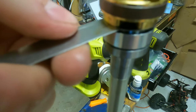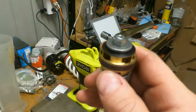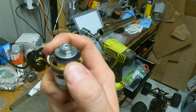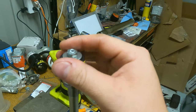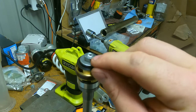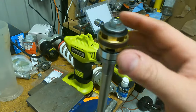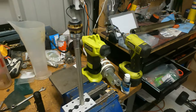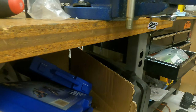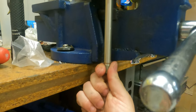Once you've confirmed float, you know you're good. You have to put all this together, hold down on it, make sure it's all the way down and moves freely. When you tighten this nut down, it's only 25 inch-pounds — put some Loctite on it and snug it down. This is the stock washer and stock nut. When you reassemble it back into the cartridge, pack these threads full of grease because they're sharp and you do not want to tear that seal. Thanks for watching and good luck with your suspension.